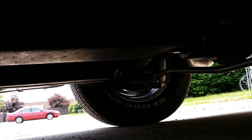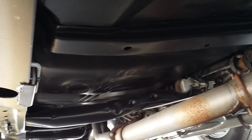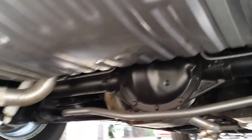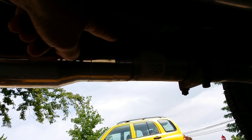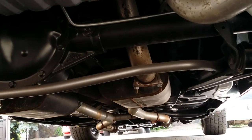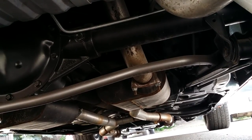Standard non-boxed control arms, but sway bar package added front and rear. Super nice car underneath — very, very comprehensive. Here's a quick look at the rear end. Housing's done really nice. Gas tank's restored. Suspension's restored. All new bushings and hardware present. Quarter panel splashes are in excellent shape. Just a really, really nice underbody. That Flowmaster system's all welded together, clamped right just past the H-pipe.